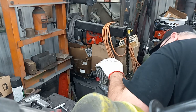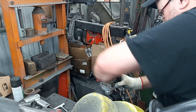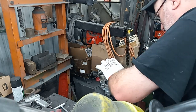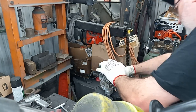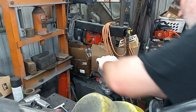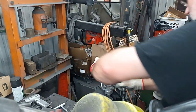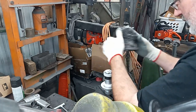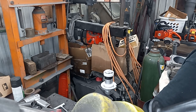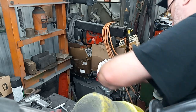And once you come down to where the base is sitting, just keep steady pressure so you're not rocking it off that base, and then do your final cleanup scrapes or whatever cuts. This cutter is really capable of doing a really good job if you're patient and understand how the tool works. I think Joe knocked it out of the park on making these for you guys that don't have the 4-jaw chuck.